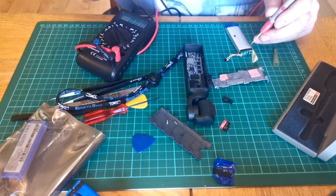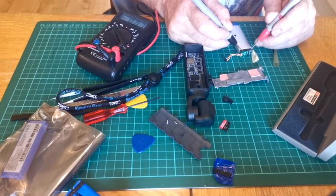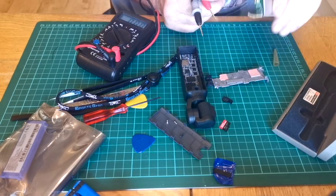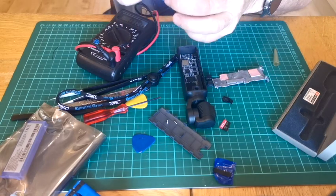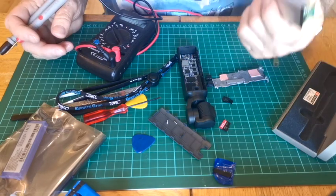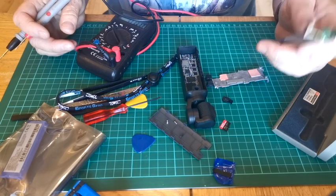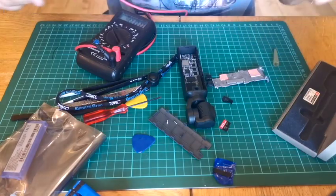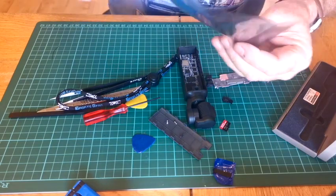Now before ordering a replacement battery, I decided, right, I'm just going to charge that cell on its own, get a couple of volts in it, get it charged up. Did work, battery got quite warm. Looking at it, that cell feels a bit puffy on the side. Yeah, anyway, the cell charged, unit charged up, powered up, worked, stayed hot. Basically it was discharging this cell rapidly. So luckily on eBay found someone that's stripping one.